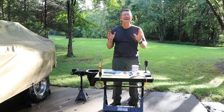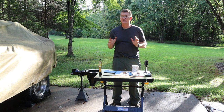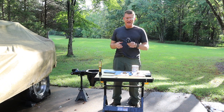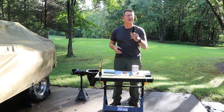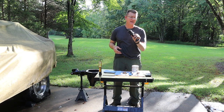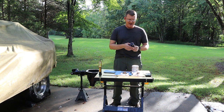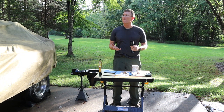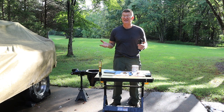Alright folks, time to change the inner axle seals. As you'll recall, I took my floor jack handle and knocked the inner seals out, and now it's time to put some new ones in. I've got this handy tool I picked up on Amazon for $34. It looks to be well made and well reviewed. Basically what it's going to do is push in our axle seal. This tool works for Dana 30s, Dana 44s, and Dana 60s, which is nice.